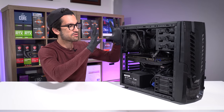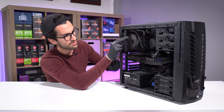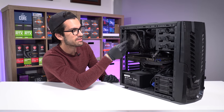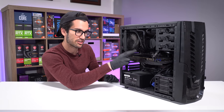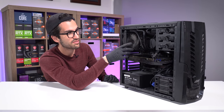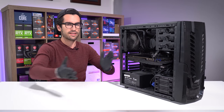So we're going to, again, replace the case, and we're going to replace the DDR4. He's got two sticks in there. He can fit 8 DIMMs in total because this is an X99 platform. 6800K from Intel in here, 120 mil AIO at the rear. He's got an 800 watt power supply. Again, that GTX 1080 Strix ROG from ASUS. And then he has, I'm not sure, a couple storage drives. He doesn't need the optical drive bay, which is nice. We don't need a case that sports 5 1/4 inch bays. I think I know what case we're gonna use as well. So we're gonna get to cleaning.